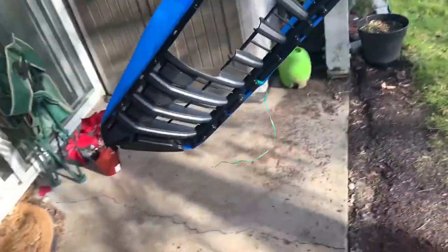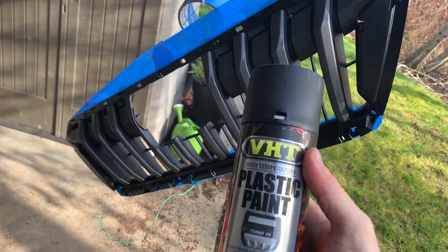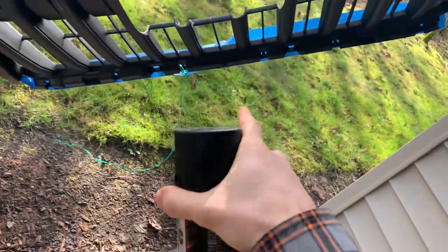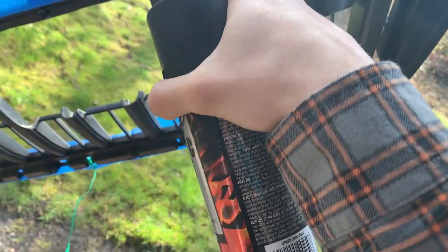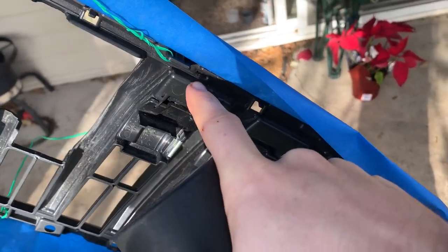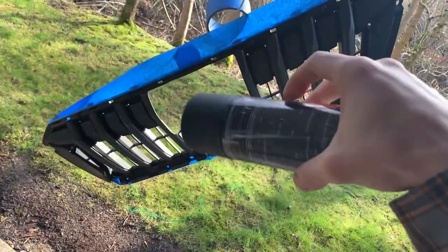So here's the painting of the grill. I don't think I've ever cared so much about a paint job in my life. I really researched and looked into this to make sure it was done right — it's on the front of a car, it's going to get beat up, and it's near a lot of other parts, it's supposed to match. I tried really hard to find paint that would match and stand the test of time, and then I followed the instructions. I 3M scotch-brighted it, prepped it with some prep spray — some kind of alcohol-based spray that gets plastic ready to paint and takes all the oils off. And then a lot of thin layers of paint and a layer or two or three of clear coat. And yeah, painted it right up.